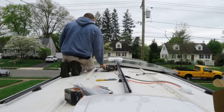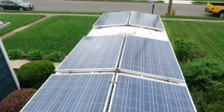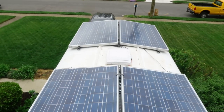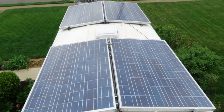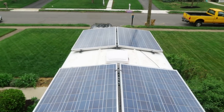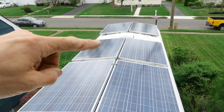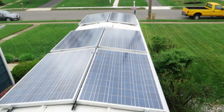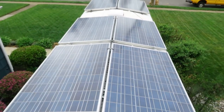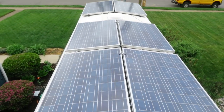The solar panels up here are wired in series-parallel — meaning that one, that one, and that one are wired together, and that one, that one, and that one are wired together. Right underneath this panel is where the wiring enters inside the bus. It's a total of 1380 watts with these panels and 96 amps.